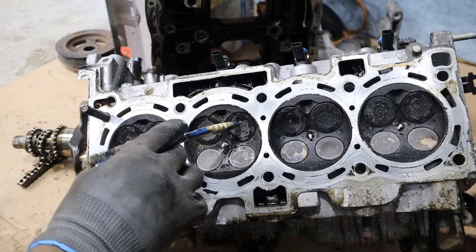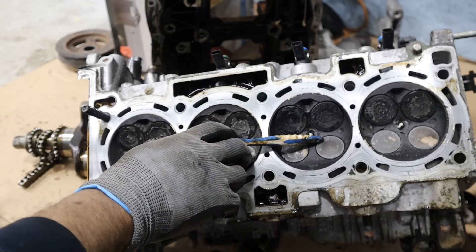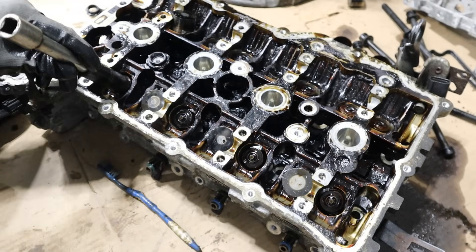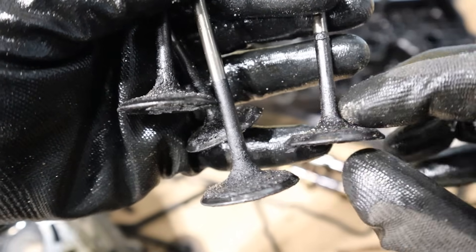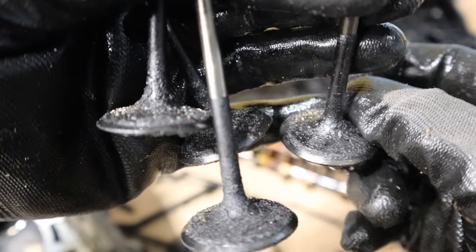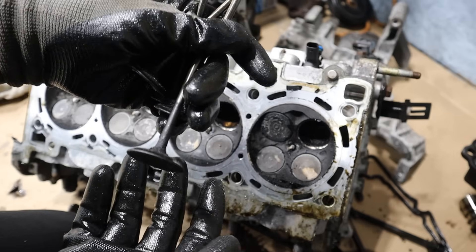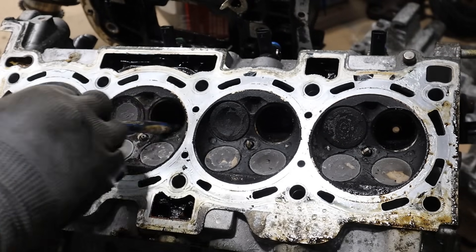Underneath the engine head — very typical gasoline direct injection. There's a lot of crust under here. This is where the direct injector comes in, and this is the spark plug — you can see the cylinder has a V-shape to it. Here's where the oil galley sends oil up into the head for lubrication. We already saw how sludged up this engine is at the top, so I'll take off some of the intake valves using my valve compression tool. The intake valves on this engine are not too bad — usually carbon would start building up more. There's only a very thin layer of crust, which makes sense at 130,000 km. This engine doesn't have EGR, which helps. It's really just the PCV system depositing carbon here, and because it's direct injection, you don't have any gasoline flowing in the ports to clean things off.